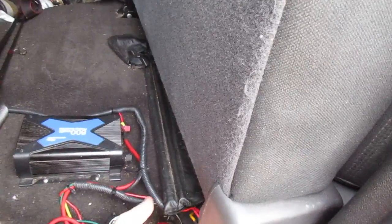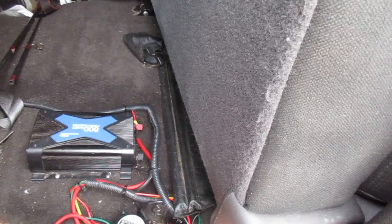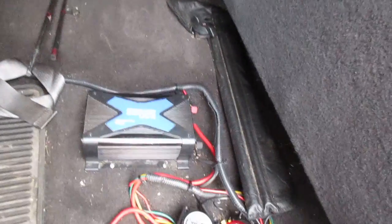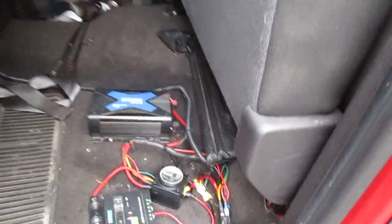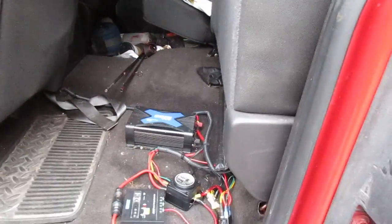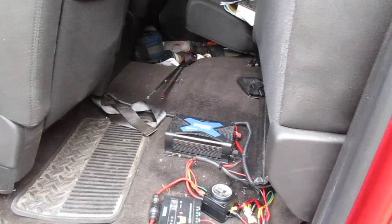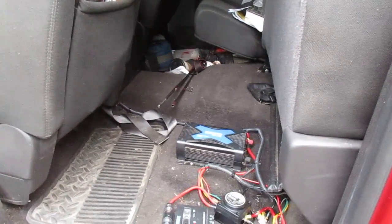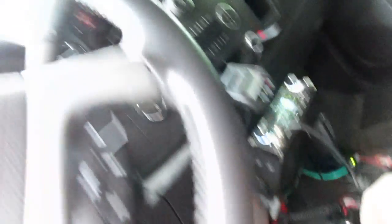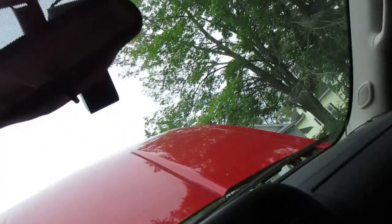This mess of wires here is the override for the low voltage disconnect — if the battery gets below 12.1 volts and I need a few extra minutes of electricity without starting the truck, I can hit that button. It also lets me change the voltage threshold. I have it set at 12.1 volts; you can set it lower theoretically with a deep cycle, but I have a relatively inexpensive marine battery so I don't want to set it too low. This switch turns on the power to the front — cell phone and dash cam.